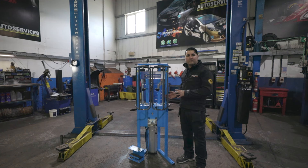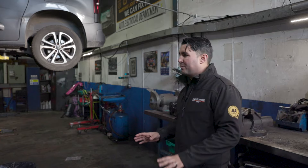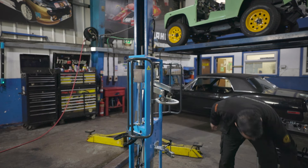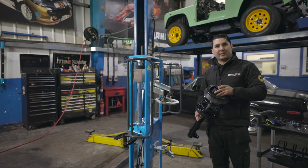Now we've had an overview of the unit, let's look at the springs and top mounts we're going to use to put it through its paces. Instead of giving it an easy ride, I've organised the two worst shock, spring and top mount combinations we can find — which is the C-Class. I'm sure every one of you knows this is the problem child of spring compressors. And the new problem child — the Nissan Qashqai with the sided springs, where the spring coils the opposite way depending on which side of the car. That 2,400 kilograms of pressure is really going to have to be put to work.